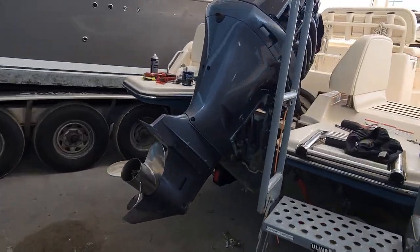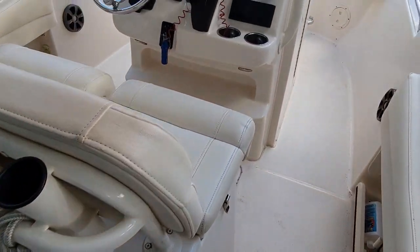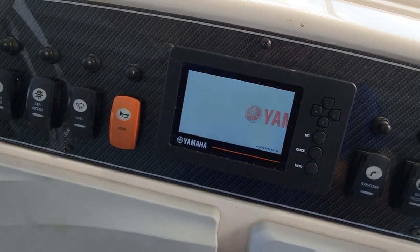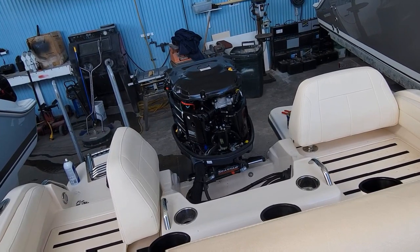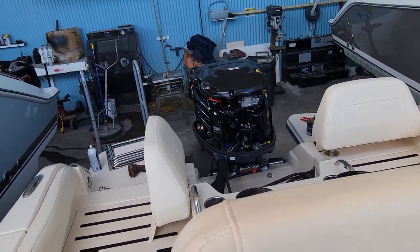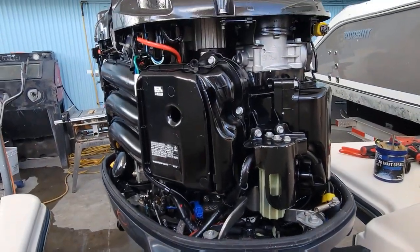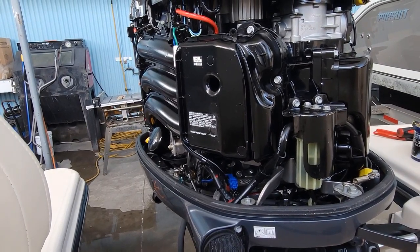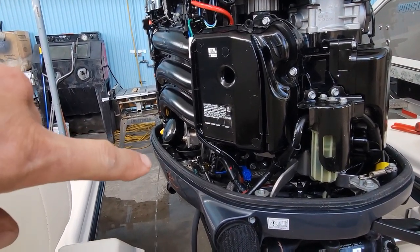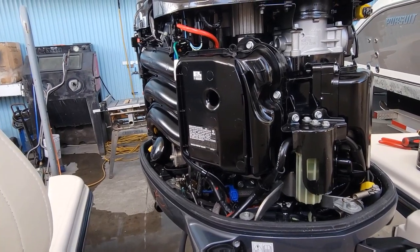All right, let's get a hose, trim this down and fire it up. Our hose connection right here. We're hooked up. Now let's fire it up. I'm gonna turn the batteries on, both, and they already are. Key. We'll listen to her roar. Enough water pressure to run it, but you don't want to rev it up or anything, or you could starve the water pump and hurt it potentially. So letting it idle is okay, but I wouldn't rev it up at all.